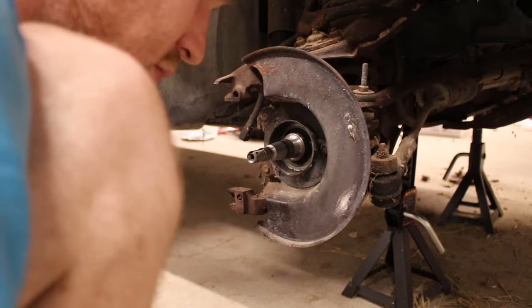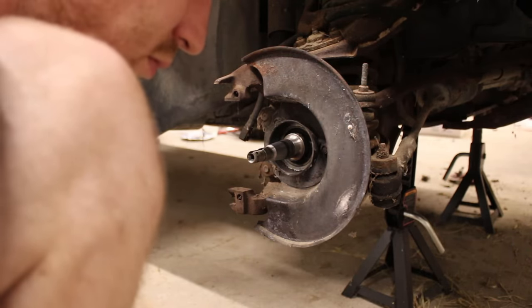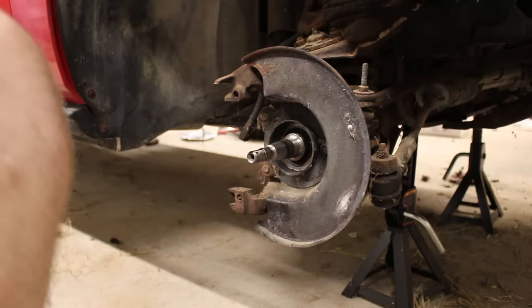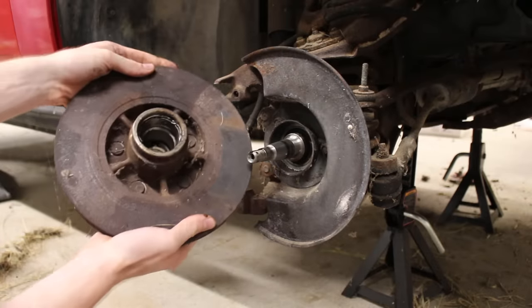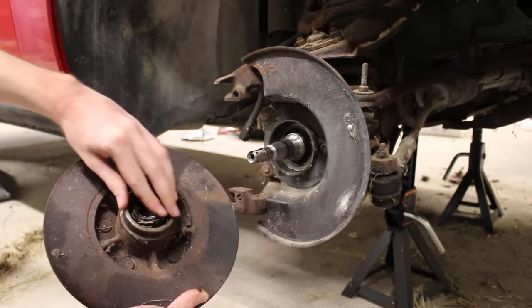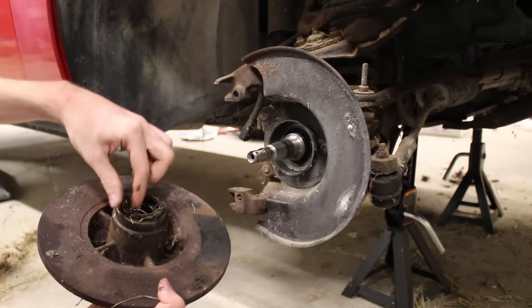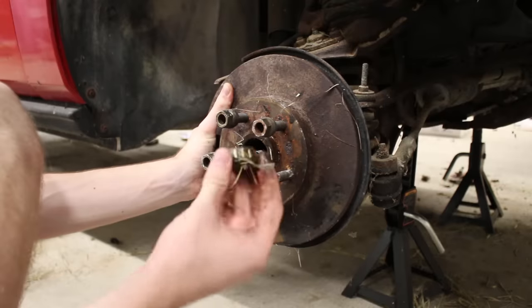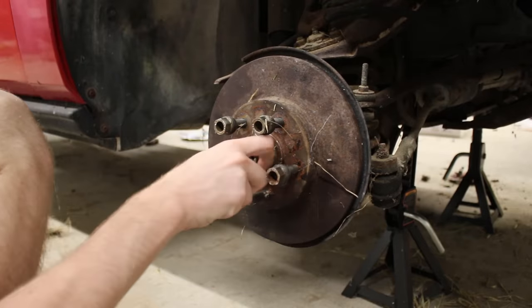Now for the front ones. These are pretty typical for front wheels that aren't driven. The rotor is clearly already removed, but to give you an idea of how it goes together, I'll take it off in reverse order — which is also called putting it back on. Here is the rotor itself, and in the back of it, a tapered roller bearing is set in place. A small seal also goes on the back of it. The rotor is then slid on the spindle, and a front tapered roller bearing is pushed into place as well. Everything is secured with a washer and a nut, and that's about it.